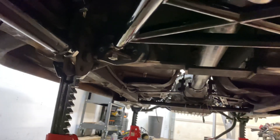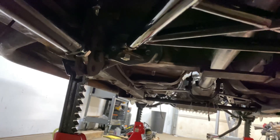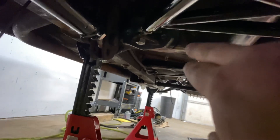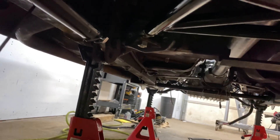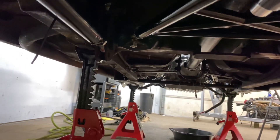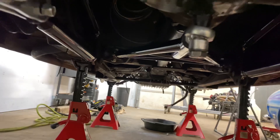It's putting up the steering on the front end. Brian came over this weekend and we basically took stuff back out and then put stuff back in the rear end. He got the mounts welded up underneath there and they are burly. These mounts used to be vertical — we cut those off and Brian made horizontal mounts so now the wishbone mounts horizontally. I do have to take the bars back out because I forgot to anti-seize them, and I want to finish painting the frame. I got the outers painted but I need to finish inside still.